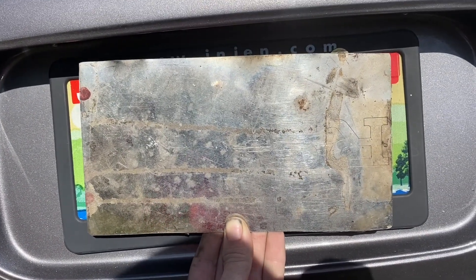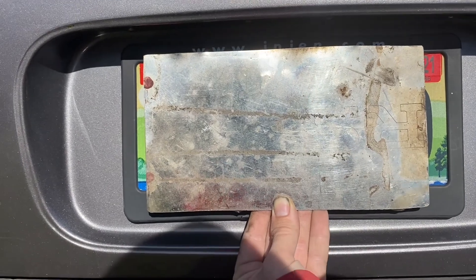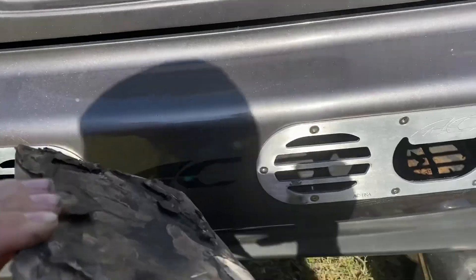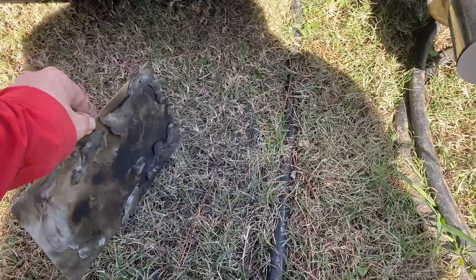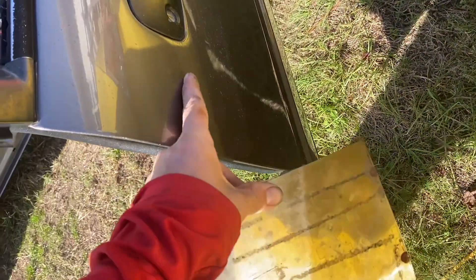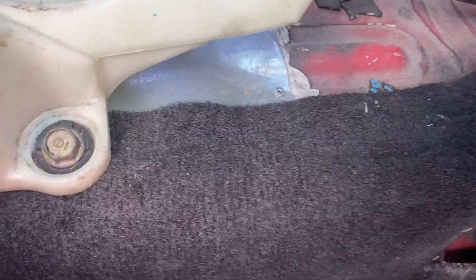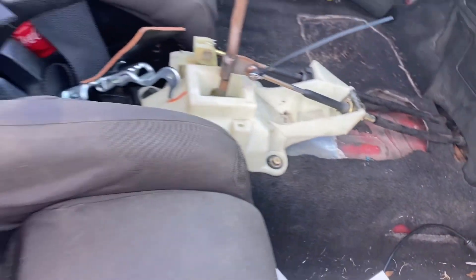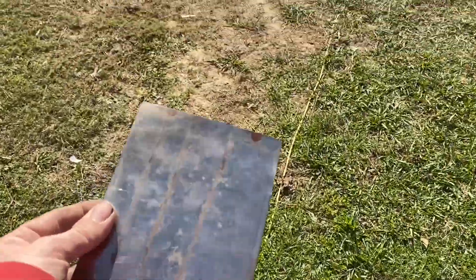This is the piece of metal we're using to cover the whole area where the shifter is. You can actually use a license plate tag — it's basically the same size; you might trim it up a little bit. If you've got an old tag or any tin or any type of metal like that, you can take it and cover it up. This one was in another automatic car and they glued it on. On my civic, I took tin and beat it to make it curve around the humps, then riveted it in with eighth-inch rivets. So there are multiple different ways of doing this.